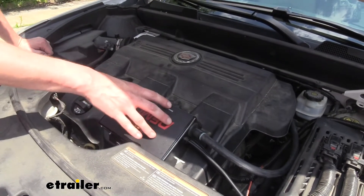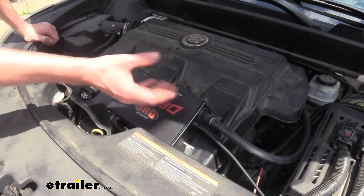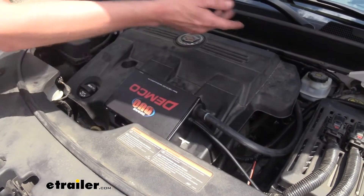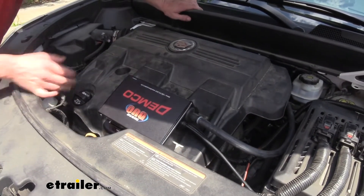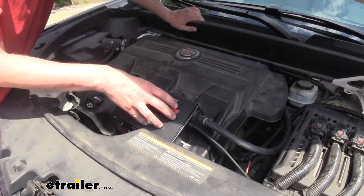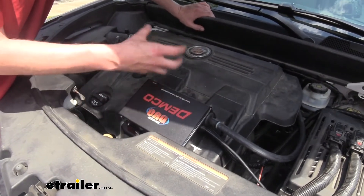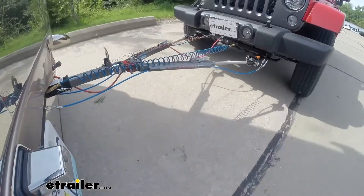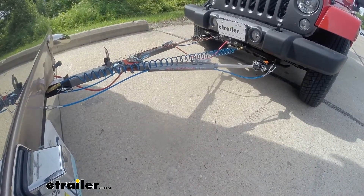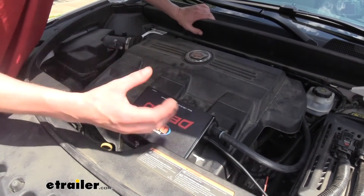Here you can see the main box for our braking system — this is the operating unit. It's the device that's actually going to pressurize the cylinder on the pedal to activate the brakes, and it's also going to pull vacuum on our brake system so we'll have power assist as well. That gives us plenty of stopping power, and since the inside components have an inertia sensor, it allows proportional braking — the harder you stop in your motorhome, the harder this system stops — so you get nice smooth braking that stops safely without wearing out components prematurely.